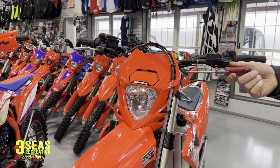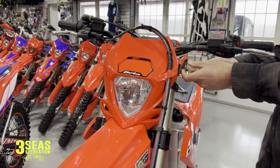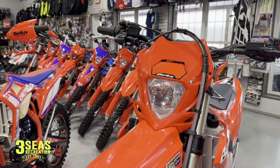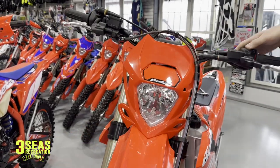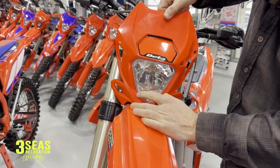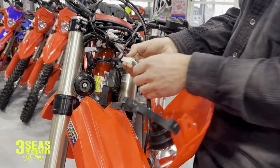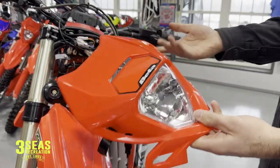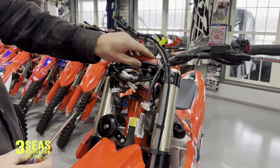So let's jump into the installation on this four stroke. The first thing we have to do is remove the headlight. I always like to start by removing the protector for the cords — it's just an 8mm on the side, a self-tapping screw. We'll just unscrew this out of here so it lets us move things around a little bit easier to get the rest of the headlight off. It's just the bands — we've got one band on each side — and now I can pick this up and out. It's still a bit tricky because you've got your front brake hose coming down over the front of it. Now that it's tilted out of the way, all we have to do is take our two light harnesses apart — it's just a simple connector disconnect. Now our headlight mask is completely off the bike. Keep this for when you want to put it back on.